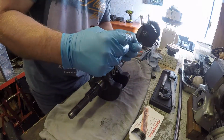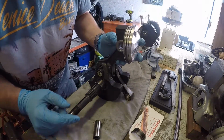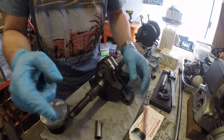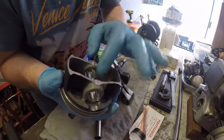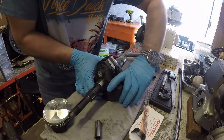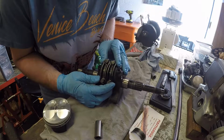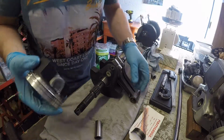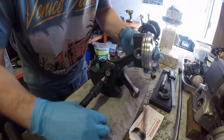What we'll do now is we'll put each of the pistons on. So it's important to note that these are free floating at this end. On later cranks, they're small end located, i.e. this gap's tight. On the early cranks, they're big end located, which is, you see the gap is very small. It's very small clearance. So if you had a later crank, you'd notice that the pistons were much tighter. When you put it on and it's like that, don't worry too much.